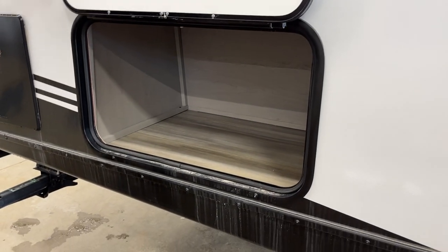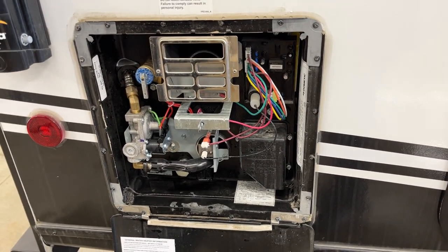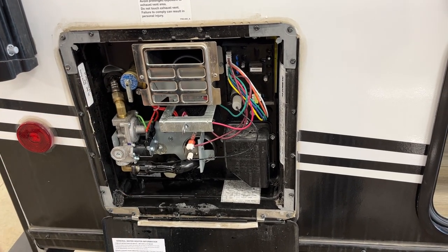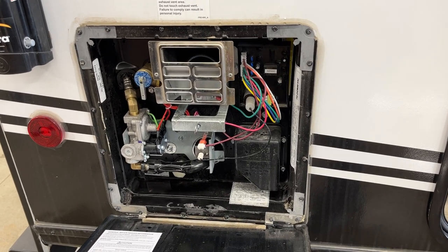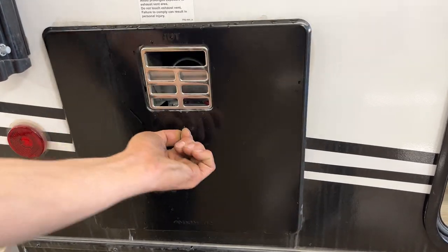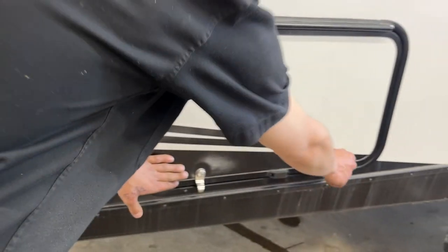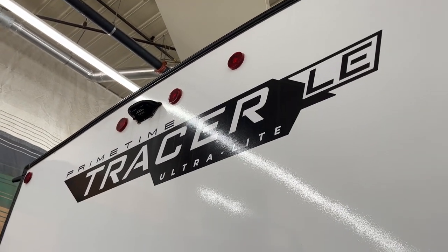There's a little storage compartment, and right beside it is your hot water tank. Take that keyway, line it up, and pop it open. All the controls for turning it on are just inside the unit. Before you turn it on though, you want to hit this relief valve — make sure you're getting water coming out. If you're not getting any water, there's a chance the tank is empty and you risk burning out your elements, so just make sure it's full before firing it up. Once you're done, lock it back down with the keyway. To the back of the unit you get your spare tire, and straight up from there you'll find a pre-wired mount for a rear-view or observation camera.